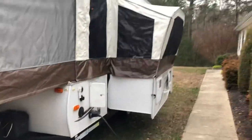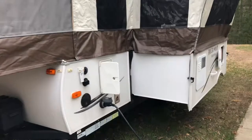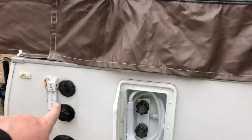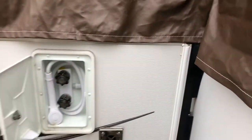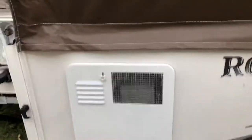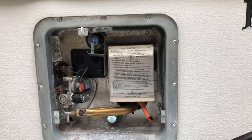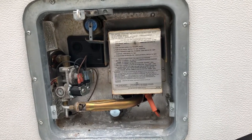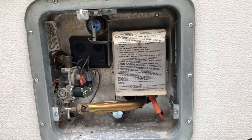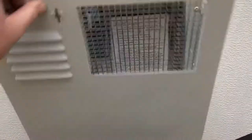You can see the slide-out in the dinette area — it's a u-shaped dinette on the inside. Moving on around, this is where all your supplies come in: your electric, your fresh water, and cable hookup on the top. There's an outside shower — a nice feature for rinsing your feet or washing a pet. Moving on around, the hot water heater — let me open this real quick. It's a six-gallon gas hot water heater with direct spark ignition. As soon as you flip the switch for hot water, if the thermostat doesn't detect hot water it will kick on automatically.